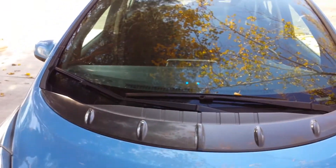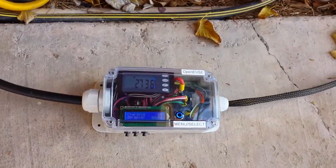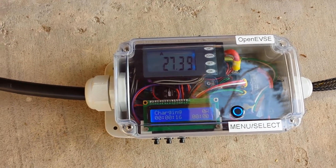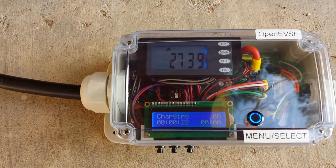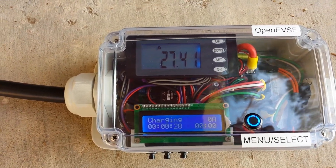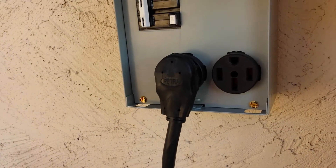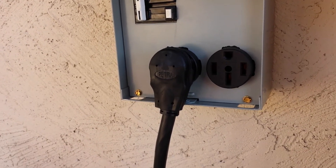Nice plug with a cap — plug it in. There you can see I've set it up. I'm not getting into the whole duty cycle rating thing, but anything under three hours and over three hours, read the posting text. I set this all the way up to 30 amps and it doesn't even warm up. The Leaf draws about 27 and a half amps. This is using a 40 amp input cable with a 50 amp NEMA 14-50 — a real popular plug.